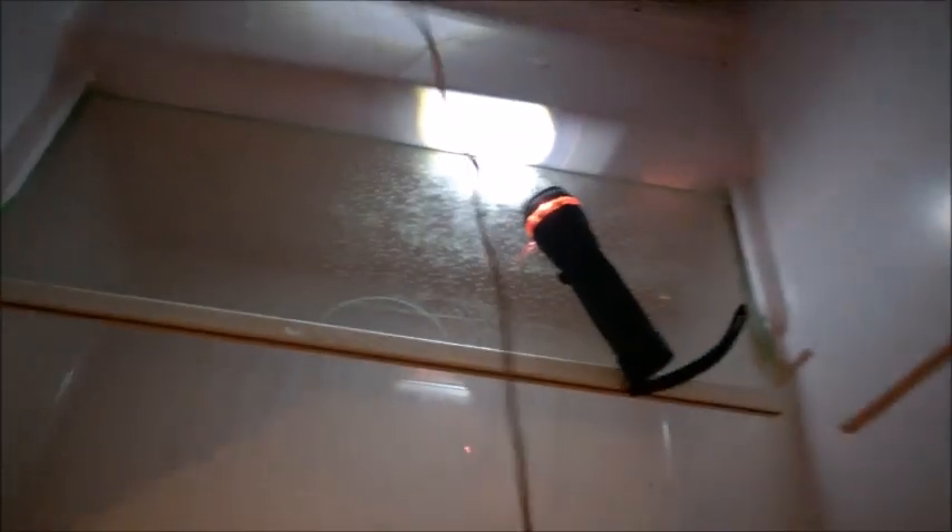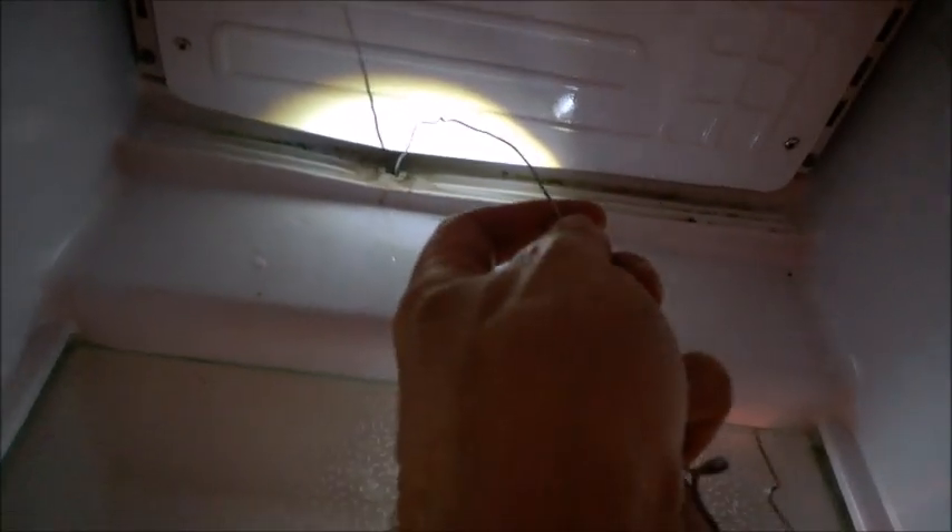Just remove the pan to have access to that hole. The water is leaking on the floor — it's really bad. So you really need to pay attention. If you have an old one that you think isn't leaking, check the floor so you won't destroy it and end up paying a couple of thousand dollars to repair. You may want to try a wire like this — just dip it into the hole, insert it on the other end where the compressor is, push it upwards, and you should be able to see it from the other side. This way you are sure you clean it very well.